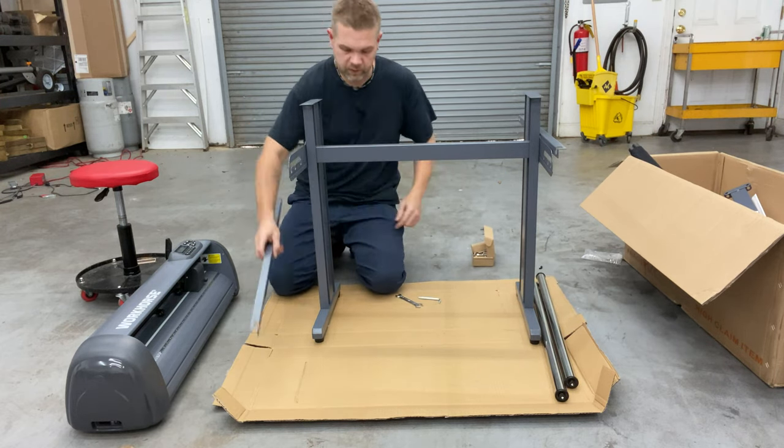We're coming to the end here. We're going to take our media rollers — these have squared-off notches on them. Slide those into place. And then last is going to be the media basket. There's really no front or back to this thing, but one side goes to the front. It goes under the legs, sets into these notches just like that, and into the front notches.